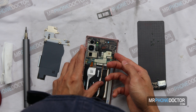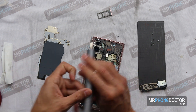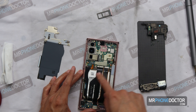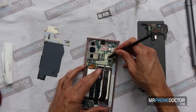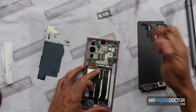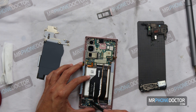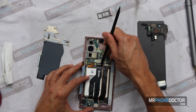Okay, it looks like we have these screws removed. There's a flex here — let's get this flex removed. Looks like the audio speaker is built into this back plate. So we have our battery, a 5G antenna, and another 5G antenna here. Let's go ahead and get these antennas removed. Then we have this flex — this looks like it's for the OLED panel for the S Pen. We have another sub key and the actual S Pen charger right here. Then we have our main flexes — this one runs power from the charging port directly up on top, so we'll disconnect that.